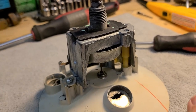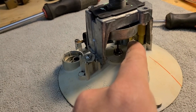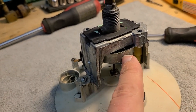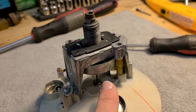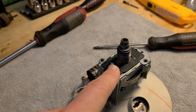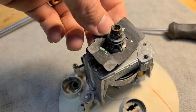Putting it back together after a new discovery: when those screws are removed the cup drops down but the internals stay put because there's actually a tiny coil spring - the return spring for the needle. It's attached on one end to the cup and the other end to the assembly. Need to be careful not to pull it downward since coil springs work rotationally, not axially.